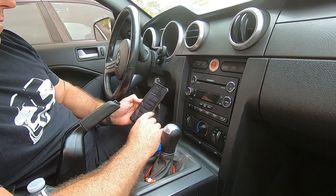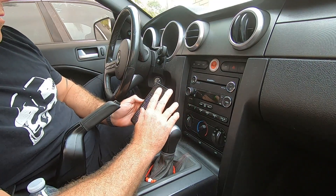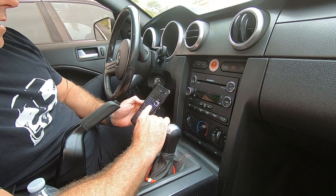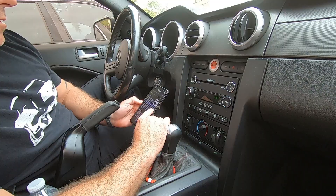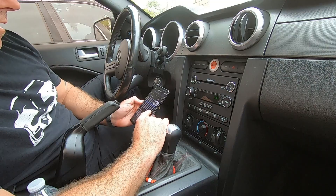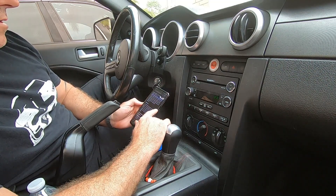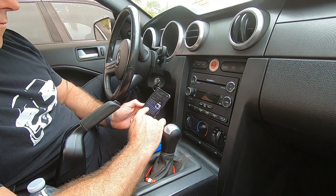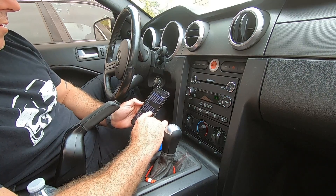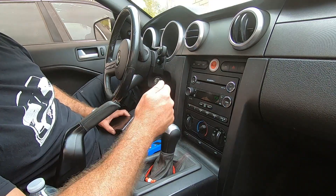Check the wiring connectors, make sure they're not loose. I've just Googled the most common fix for P0193 and it says to replace the fuel rail pressure sensor itself. Other potential causes include checking the wiring. So we're gonna go out there and check the connections. This is interesting — I haven't used AI yet to try and diagnose a car, but now I want to go out and inspect the wiring harness and the connector and make sure everything's good.